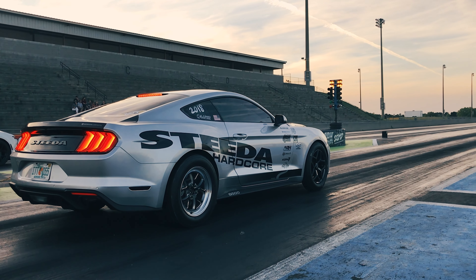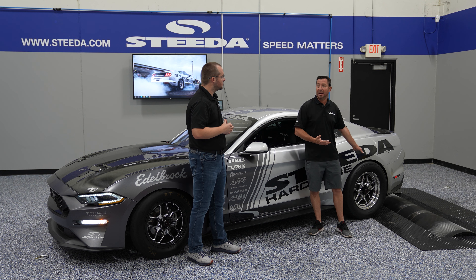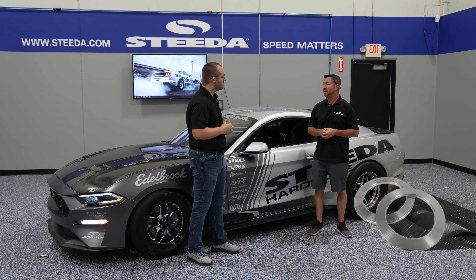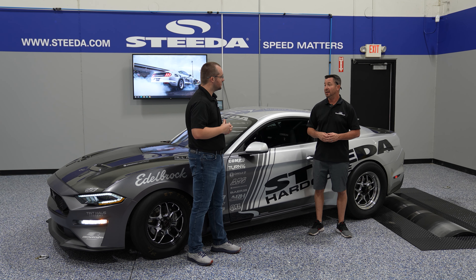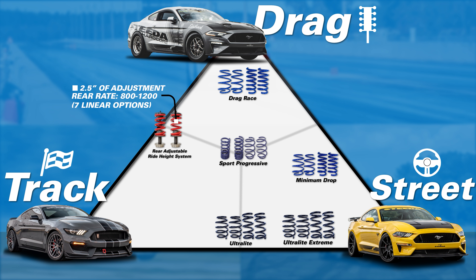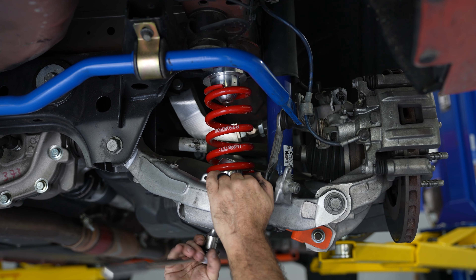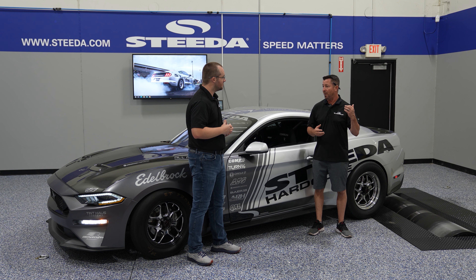Depending on application, we leave off the foot brake with this car. Some customers have the back end coming down a little too hard on the tire, so we offer spring spacers to really dial in that combination. For more of the hardcore guys, we've got our new adjustable rear ride height kit. From a drag racing standpoint, you might have your street wheels and tires and want to lower the car down and make it look aggressive with a simple half inch socket drive. Then when you want to go beat it up on the weekends at the 1320, put on your big sticky Mickeys and you can raise that rear end right back up — super simple. The kit also works with some of our handling springs as well for the track guys testing out different spring rates.